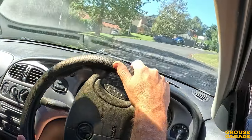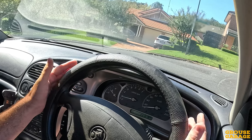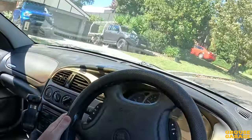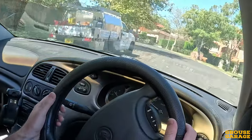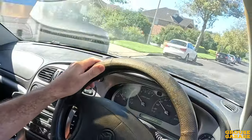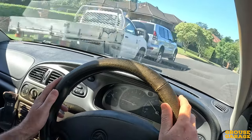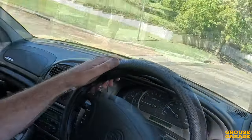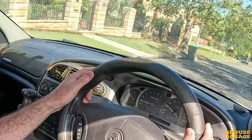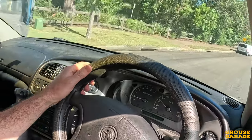That feels the same because it was pretty responsive and powerful without the tune. Pulling up here — every time I pulled up at this intersection previously it would stall. Perfect. That kick down is really good. It kicks down perfectly exactly where I want it to. We'll just coast along on this stretch of road now — going downhill, so it's idling nicely as I'm coasting. When I went through this stretch of road before, coasting down this hill, it would feel like it was definitely idling too low and wanting to stall. But we're sitting just under 1,000 RPM there.